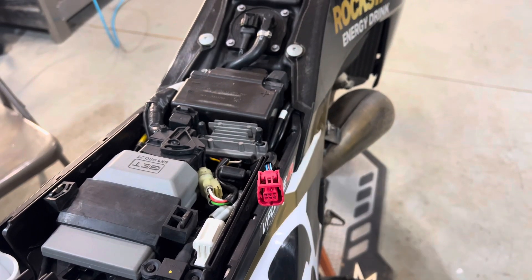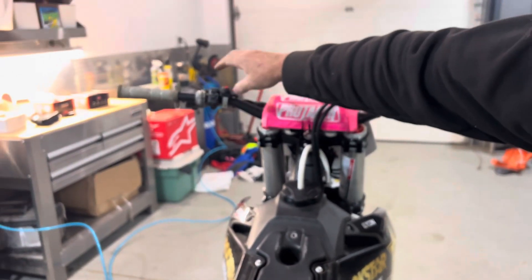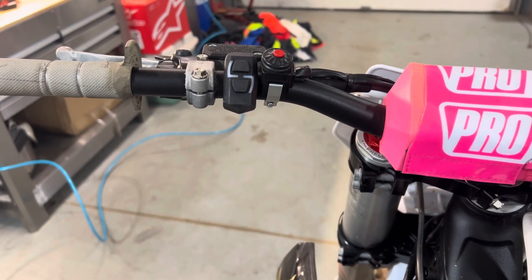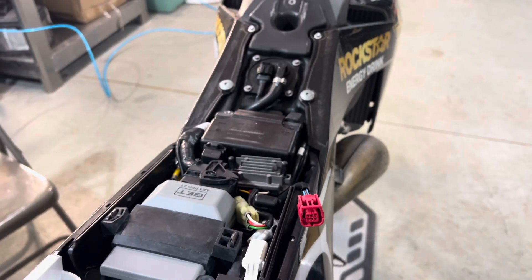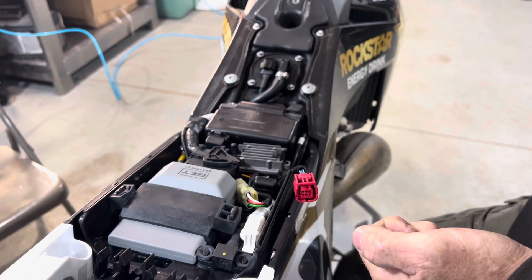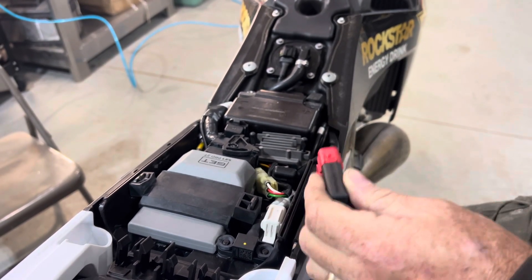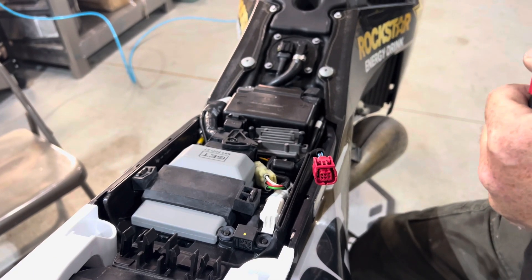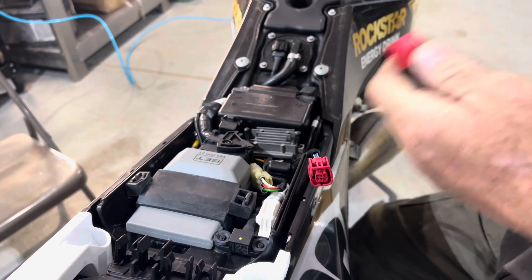What we're going to do right now is set the endpoints to the power valve on both maps. When I plug this in, the map switch is going to light up green or white. We're going to reset it, unplug the wake-up connector, run it for about 10 seconds just to make sure it's not doing anything funny, then shut it off, and replug the wake-up connector to do it on both maps. It's not in the GET manual or the stock OEM manual to reset it on both maps — it only says plug it in and do it.